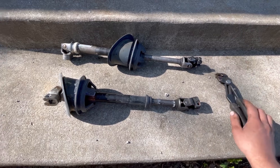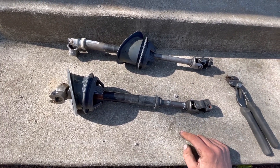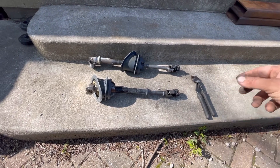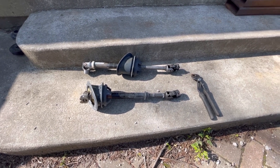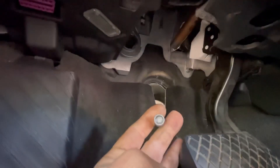If you've got notchy, hard steering, this is one of the first culprits. If it's not notchy, then it could be the power steering pump — I've had to replace one of those before, but it's very rare. They do take a special type of mineral fluid, not your standard power steering fluid, so don't mix your fluids up. You simply unbolt it right here — triple square.